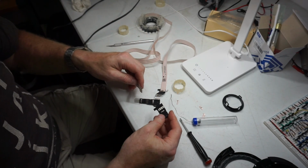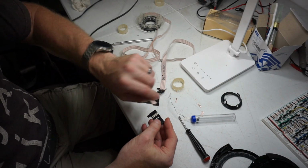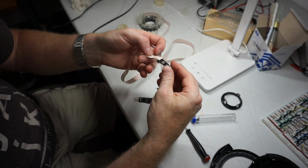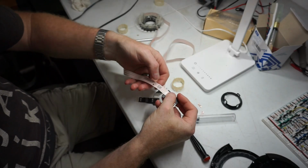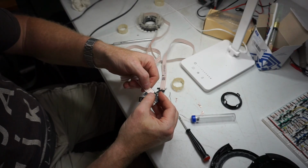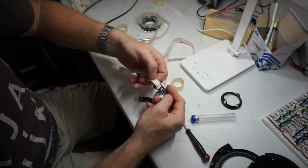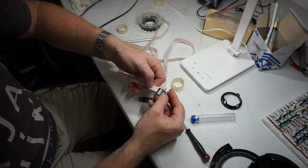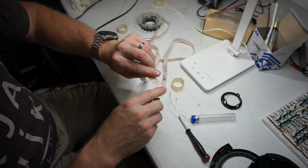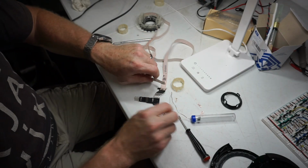The only thing that's going to be a problem with this one is that I had it torn off in a pattern so I could tell which way it went. But I'm going to have to assume because it's wrapped like that it went this way, which would make sense because the barcode's up. So that's the way I'm going to put it. Hopefully I'm not putting it the wrong way, otherwise I'll have 2 wires off. But I feel pretty good about soldering it that way. I'm pretty sure it's bent like that. So let me do that. I'll scrape this clean, tin these, and melt it on, and I'll check back.